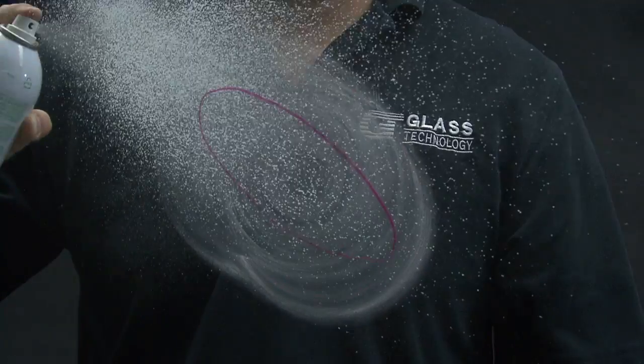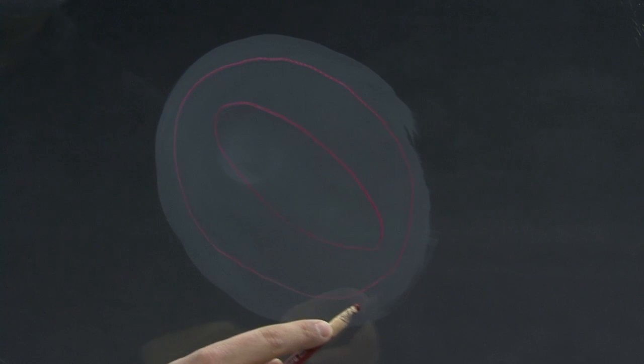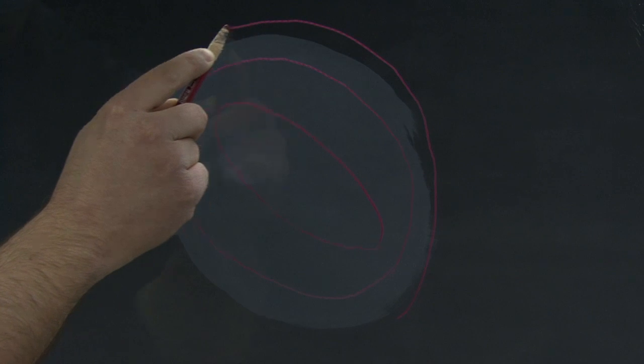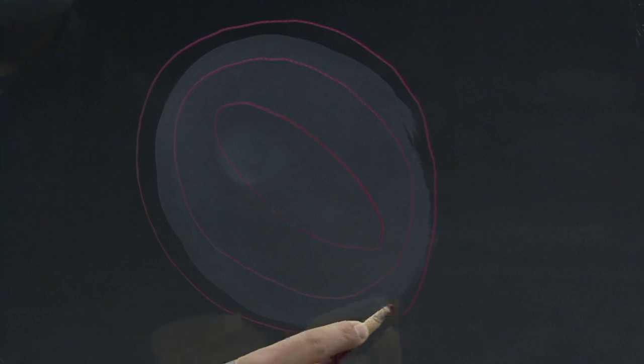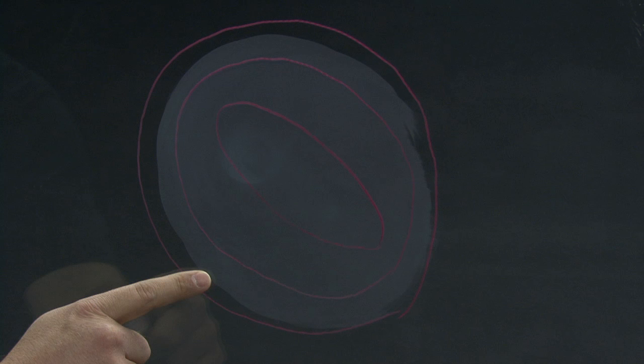Clean the surface of the glass to check for a consistent cutting pattern with the desired amount of overlap. Using the marker lines to distinguish between the two sanding areas, determine whether the heavier cutting pattern has been completely removed or replaced by the lighter cutting pattern of the 320 grit. If not, go over the area a second time with another 320 grit sanding disc. Finish by outlining the final cutting pattern.